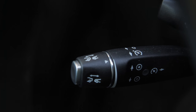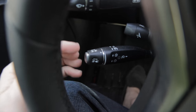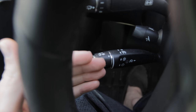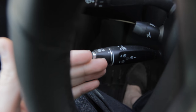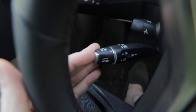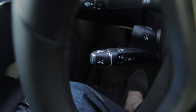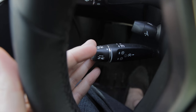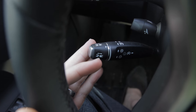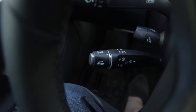There's a zero and then there's a cruise control icon — that refers to the backward and forward pushing of the lever. Pushing backwards will reset or deactivate it, whether that's auto steer or cruise control. Pulling it forward will activate it or set it to the desired speed. Pulling it once will activate just the adaptive cruise control; pulling it twice will activate auto steer, if it's available and activated in that particular vehicle.